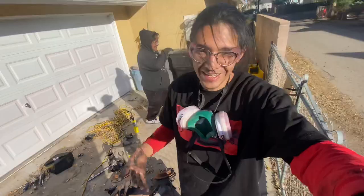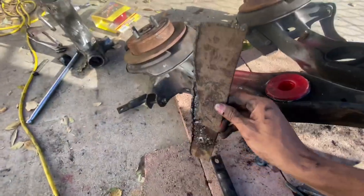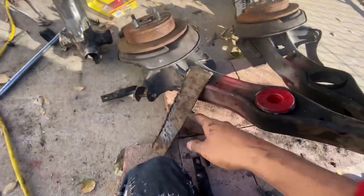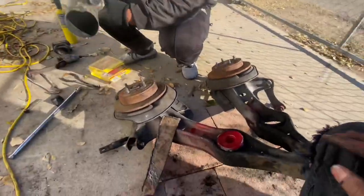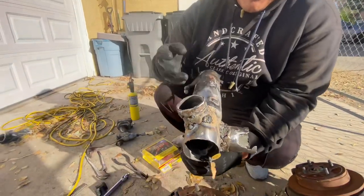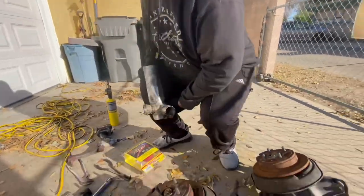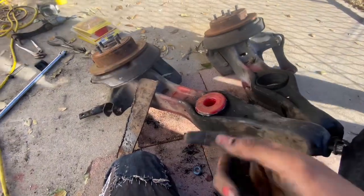So there are many ways to do any task. This is the way we took. Piece of steel, some strange contraption he made. Put the steel on the bushing. Leo stood on that like a mini pogo stick, and the bushing popped right in. Dana said it's a potato gun. You see, you got your little sightsee, you got your little trigger right here. Or you could go to AutoZone and get a ball joint press and pop these guys in too.